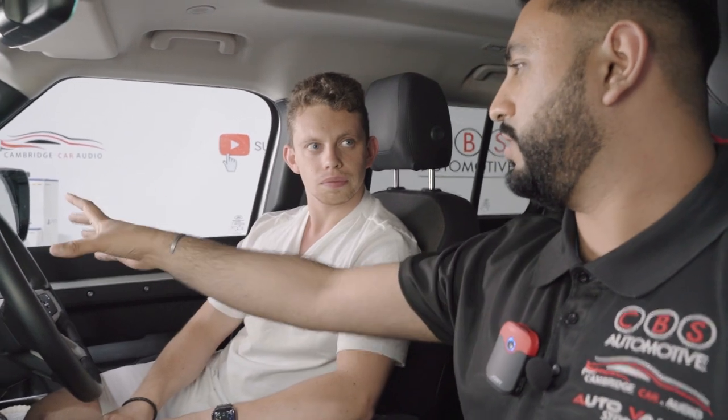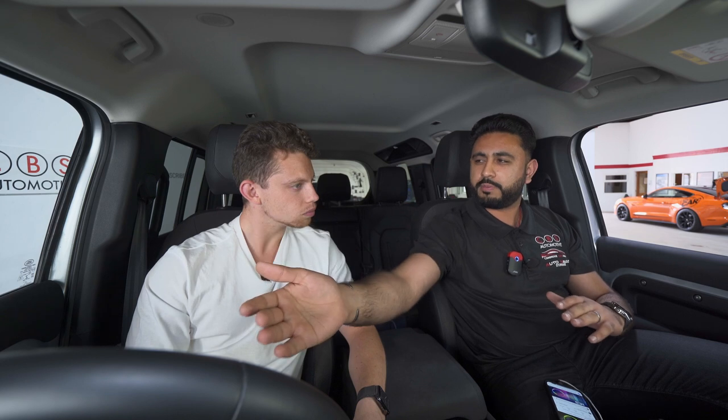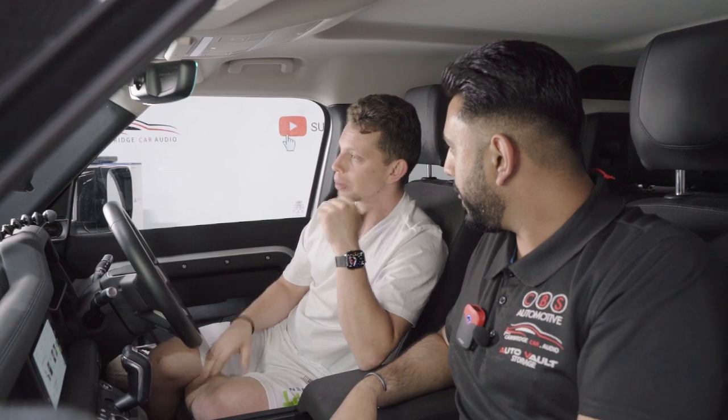So yeah, it's a time delay. You increase and delay each output that each speaker plays at. Because that tweeter is closer to you - it's very minimal though. Because that tweeter is closer to you than this tweeter, we want to increase the speed at which that plays so it lands at you at the same rate as the other tweeter. Because it is physically closer - physically there's a difference. So the main problem I had before with my sub was that it worked and delivered the bass, but it was definitely out of time - the bass was after, say, a bass drum hit - the sub would play after the rest of the car because there was no timing involved.